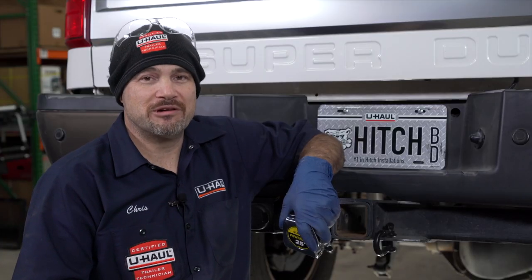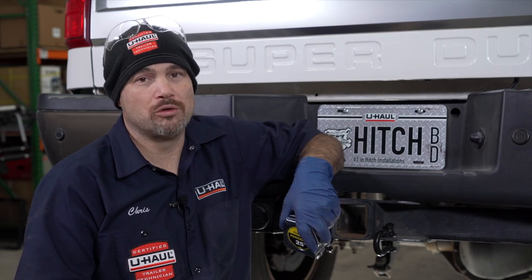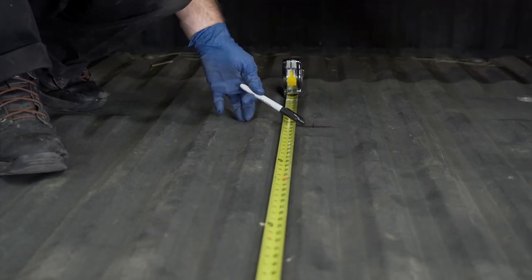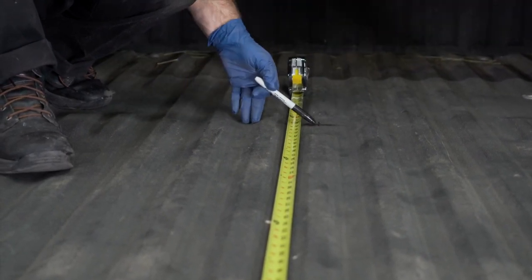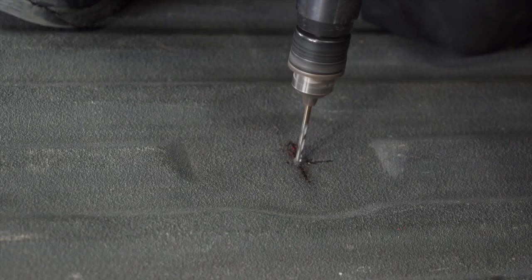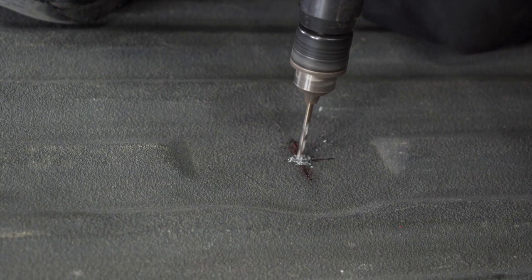Now that we have prepared the underside of the vehicle for the installation, we're ready to mark and drill our 4-inch hole. From the rear of the truck bed, we will take our measurement and find the dead center. Once we've made our mark in the dead center, we're going to drill a tiny pilot hole with a small bit like a 3/16ths, and then we will come back with our 4-inch hole saw with an arbor.